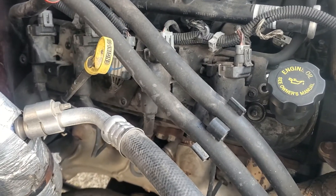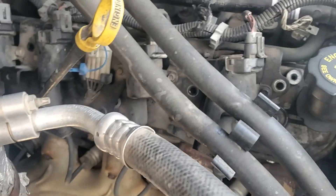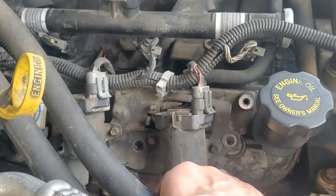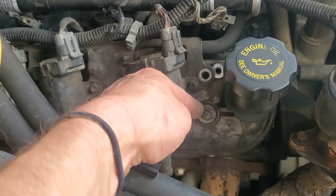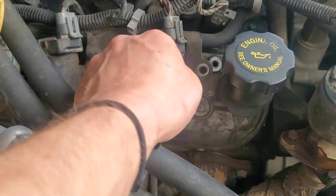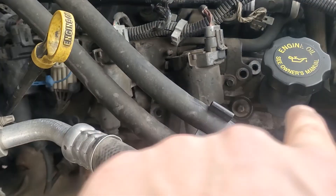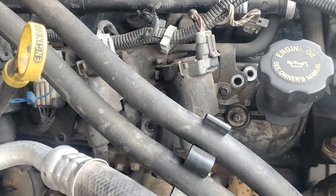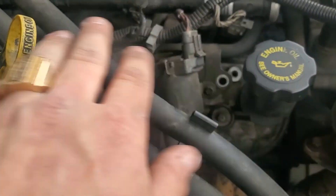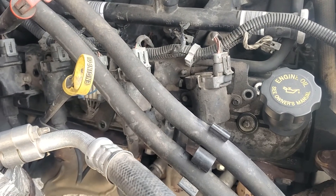So those are the coil bracket bolts, and then you can just kind of lift these out of the way. I'm not going to disconnect the spark plugs or anything. I'm just going to go straight to the valve cover bolts, which are right there — these are eights — and then take those off and check all of the valves and all of the rocker arm bolts, make sure that they're all good and tight, and then I will move to the driver's side, which is basically the same thing, and do it over there.